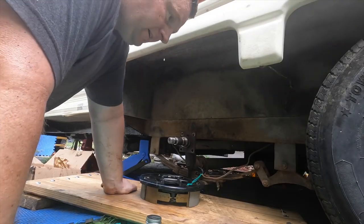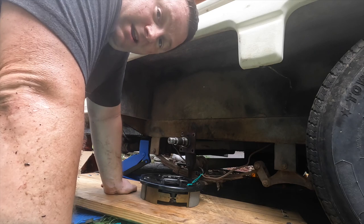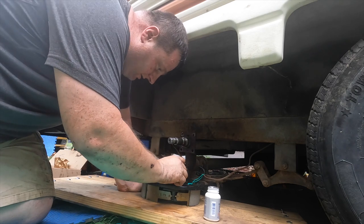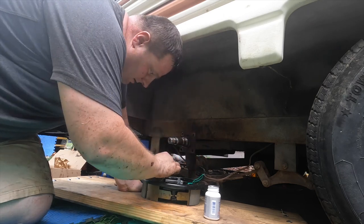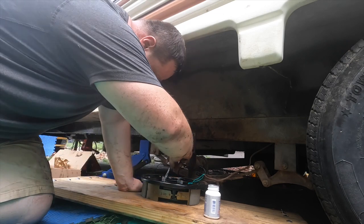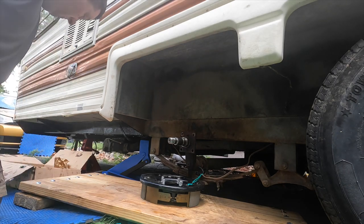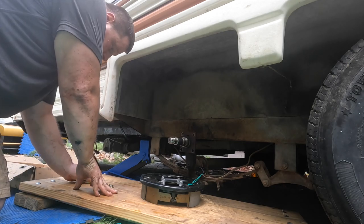I got the electrical wiring done and I feel like it's pretty good. That electrical tape looks like crud — that Harbor Freight stuff's terrible, never buying it again. So now we're actually going to put everything back together — it's downhill from here. This right here is anti-seize lubricant. I'm putting it on the bolts — it was suggested by a friend — and it'll keep my nuts from rusting. It's not going to make them loose or anything like that. I am putting locking washers on there. I do have to use one of the old nuts unfortunately, but other than that I've got all new ones.